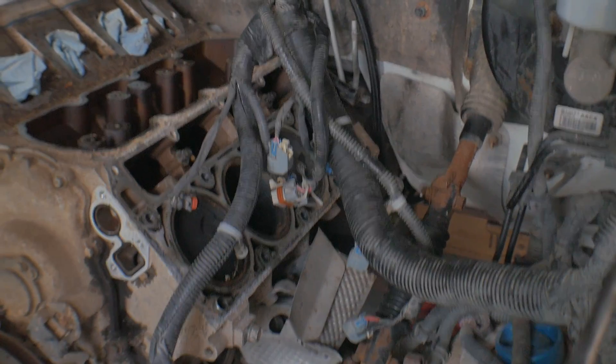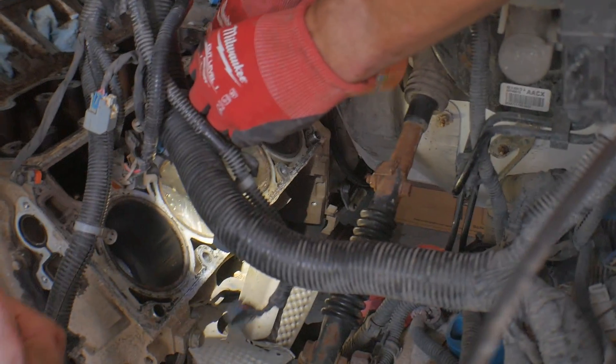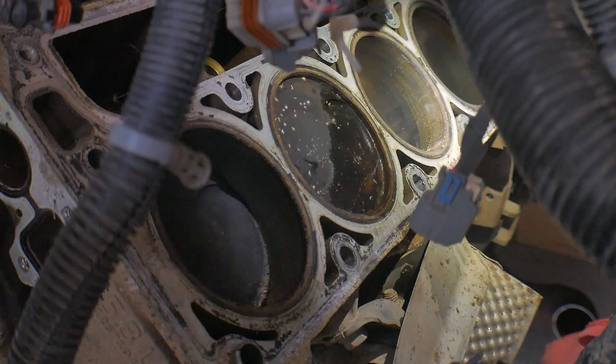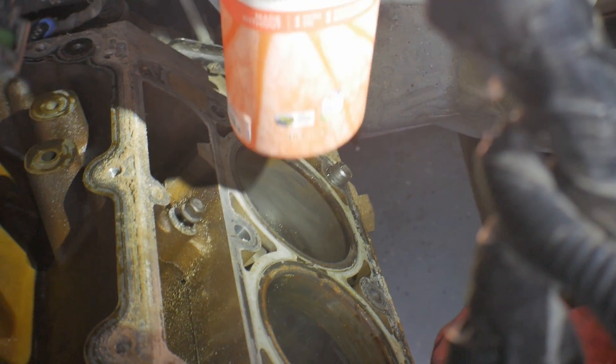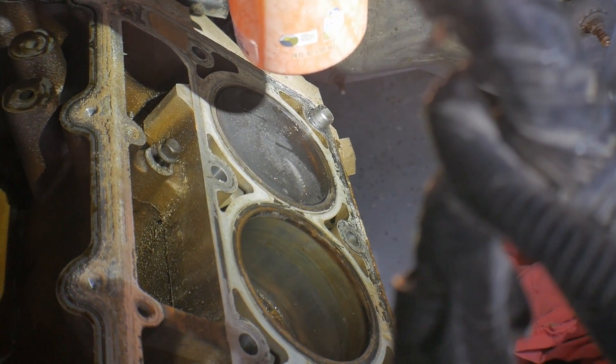You know how we talked about having low compression in Cylinder 3? Just go ahead and listen and you'll hear it. Get the mic in closer, Paul. You can hear it. You can also see bubbling up with the antifreeze back in Cylinder 3 as well. Either way, you can hear it. That's why this thing is coming out — it's going to get a monster rebuild.